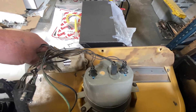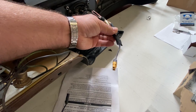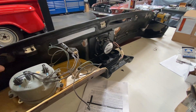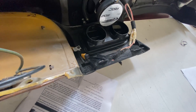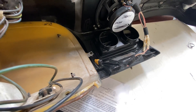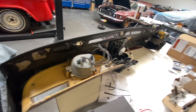I'll be saving the stock switch to make everything look stock. The people from Arc Audio look like they did a center channel, which explains why this thing sounds so nice, and they used a real high-end type plug. I want to say it's a 4.7 microfarad capacitor — that's what I used to use in tweeters. That is the vent diffuser from Vintage Air, and once I put the hoses on these I usually take a screw and run it through a corner just to set it on there and prevent it from coming loose, because there's nothing worse than having a hose pop off and realize the AC is blowing cold air on the windshield instead of the passenger side.